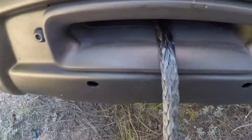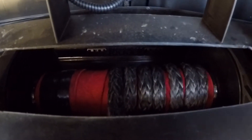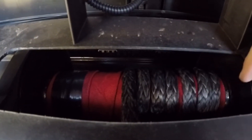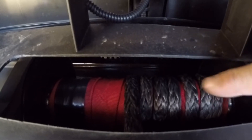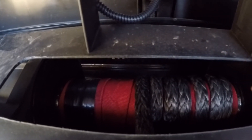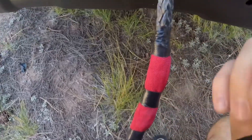What I did is I took the strap off the rope itself, took the rope off the winch, wrapped the strap around the drum, and ran some electrical tape around it — so now it's got like a heat shield on the drum. Then I wound up the rope and put my last little piece of strap here just so I know when I'm pulling out my rope that's as far as I can go. So now I'm going to wind it back up.